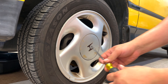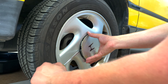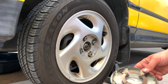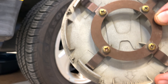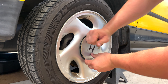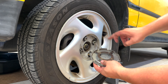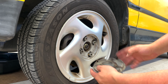I'm going to pop these wheel covers off real quick. Just an FYI — the rims have an indication of which side they go on. When putting them back, make sure the arrow points to the valve, because sometimes when people snap these back on, the tabs on the side break and they never really stay on after that. So make sure this arrow is always pointing to the valve and you'll never have an issue.